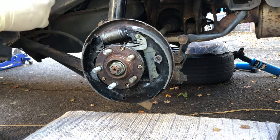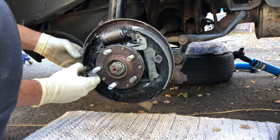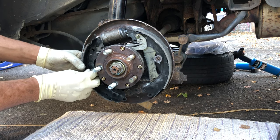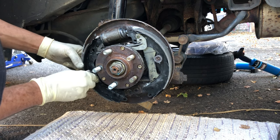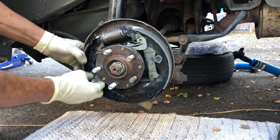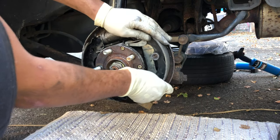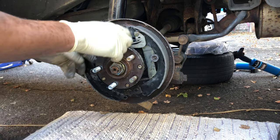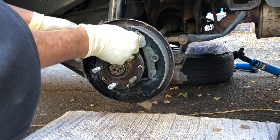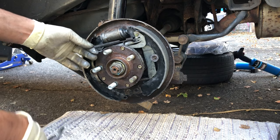Now we get the pin and the spring for the other side. Okay, pass it in the shoe, hold it in the back. Get your plate, line it up. Here you go. Make sure it's nice and tight. Okay, get the adjuster on, the rear spring on. Go ahead now, put the front spring. It goes here, and then I'll get the long cutter or whatever works for you.